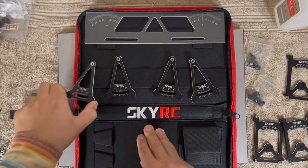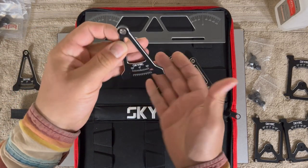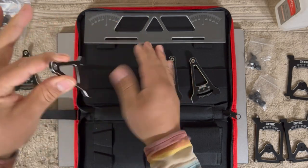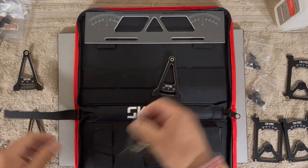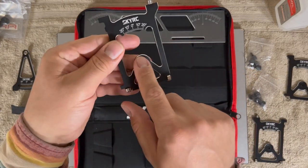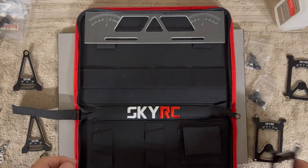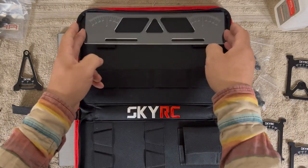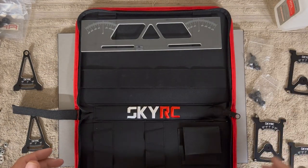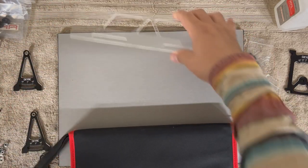Do not drop these. From time to time you can oil them — use a very, very light oil so they move smoothly. The fixed ones just attach to the board. The rolling ones are where your wheels attach, and they move in and out. These measure your toe in and toe out, and the camber gauges measure camber — something very important that a lot of people neglect, especially when starting out.